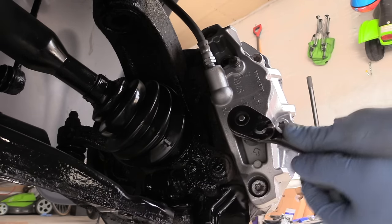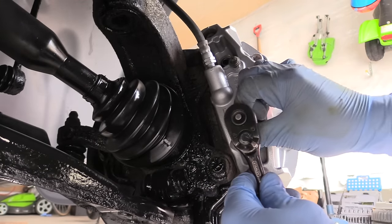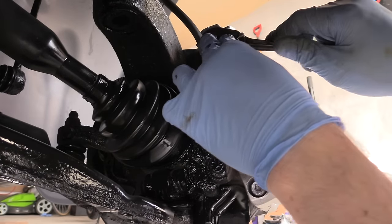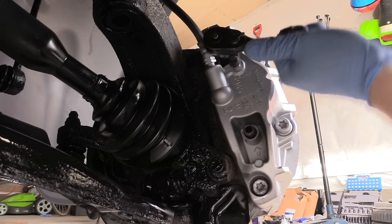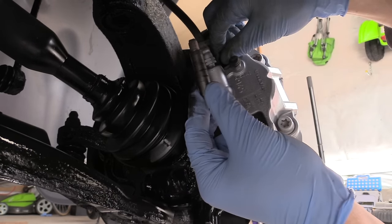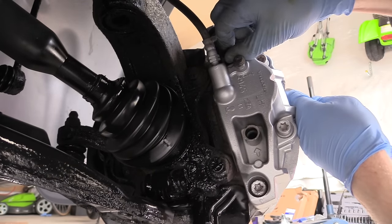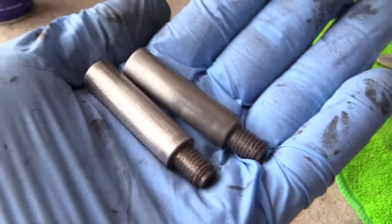As you can see, the suspension components are freshly painted here. I've missed a couple of spots, but once I remove the caliper and the rotor I will respray all the missed areas and give it another few coats. There's also a video on how to replace the brake fluid on my Volvo. Once you take out the locating pins, you want to clean them really well — I'm using fine sandpaper or a wire brush. Once they're clean, they look great.